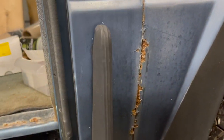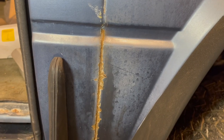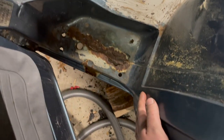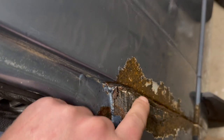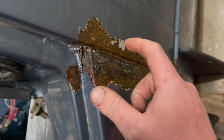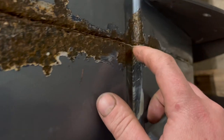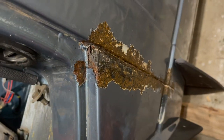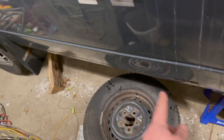Just going through and treating the rust spots — going to neutralize it. Going around the bottom of the sliding door, a couple of little spots, brushing it back and putting some SEM Rust Mort on it. All the seam sealer has been picked out and brushed with a wire brush; we'll put some SEM Rust Mort on there and it'll be good. We've got multiple layers of crusty material in some spots. This panel seems fine; this panel is bad. Down here it's crusty, but this panel seems fine — this one is bad. So at least this arch and down here needs the rocker and that arch replaced.